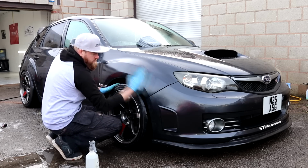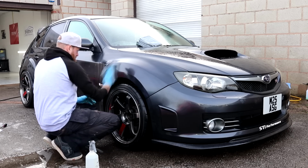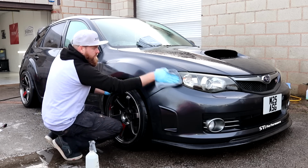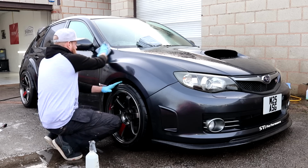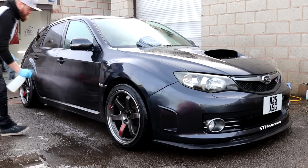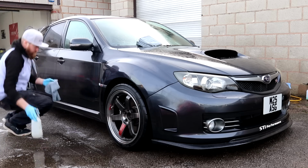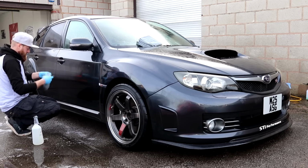I'm pretty sure it is also capable of removing other types of greasy contamination, so my preferred method is to clean all areas of paintwork, wheels and windows using this product. It is very important to remove all of the different types of contamination from a vehicle prior to machine polishing, because if we didn't remove all of the contamination that was present, then the chances of it becoming trapped in the polishing and cutting pads is pretty high.